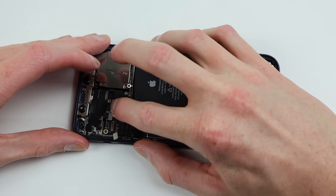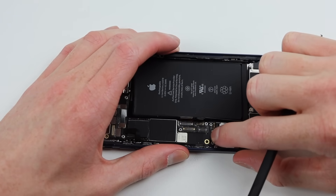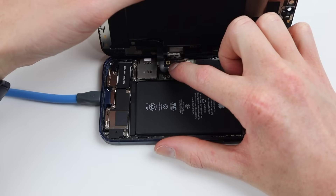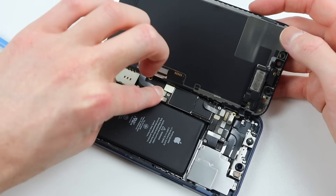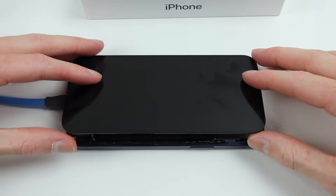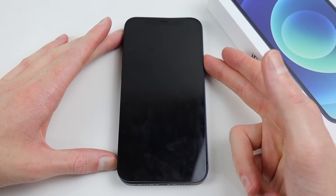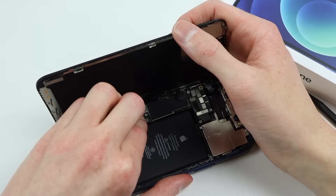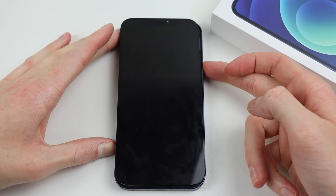With the logic board removed, we can see both iPhone 12s have been disassembled part way. I'm going to swap the iPhone 12 logic board from our red phone into the blue one. Apple's known for pairing everything inside their phones, so if my theory is correct, this phone isn't going to be very happy when I reconnect everything and power it on. After reinstalling the logic board and connecting the display cables and other flex cables, I pressed and held the power button — nothing happened. I lifted the display panel and reseated the display connections, pressed and held the power button again — still nothing.